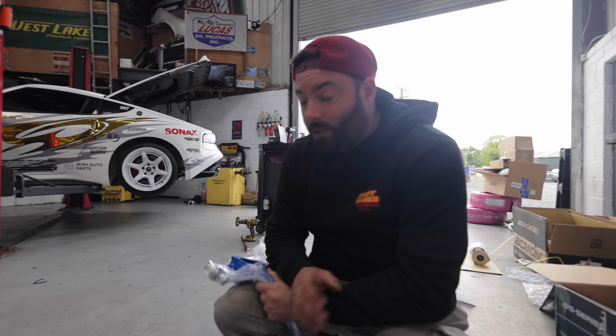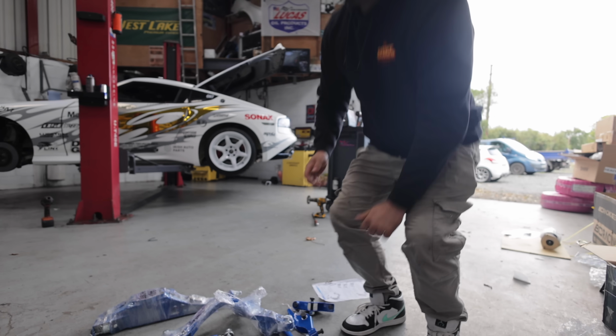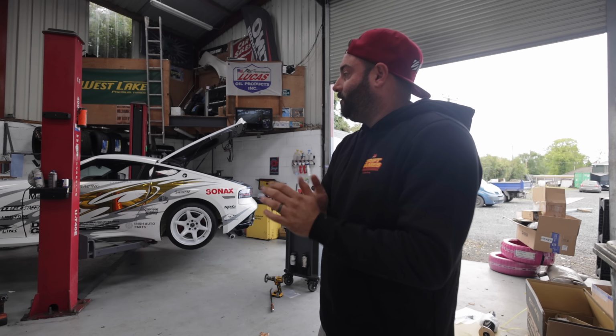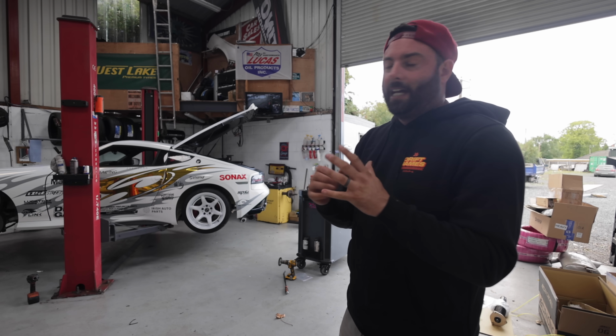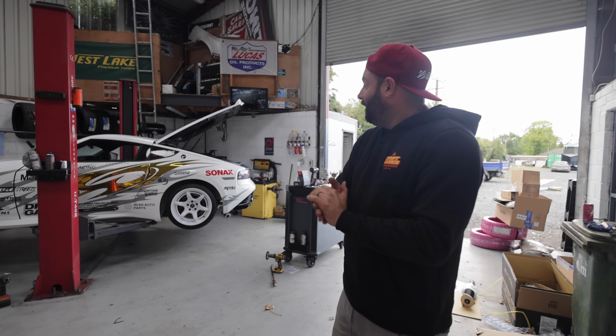So we're going to throw it in the car, and our big worry with this kit is how wide the wisefab makes the track on the front. So we're hoping that we went for a smaller 9-inch wheel on the front, so that it creeps in between the arch. If it doesn't, we're going to have problems, but we've gone for a 235 front tire, a 9 on the front. Hopefully it fits over the caliper. So this is probably the last hurdle. If we get this in and there's no issues, we're ready to send her.